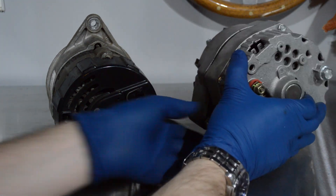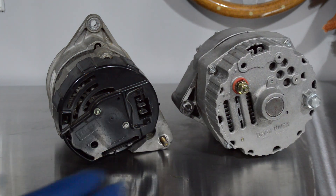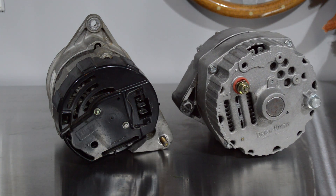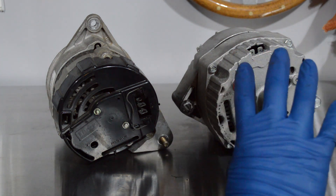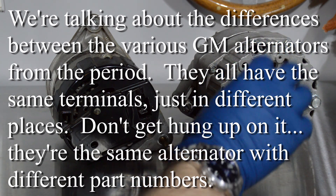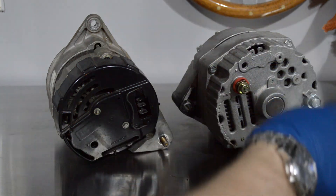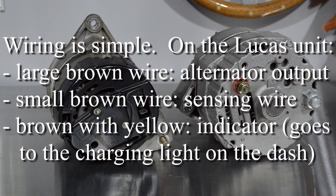You could look at, like a late 70s, early 80s Chevrolet — it'll have an alternator a lot like that. Where you get the differences is this back part can actually be detached and you can rotate it. So if you've got a fitment issue, you can have the connections on any of the four sides. Other than that, they're basically very much the same alternator.